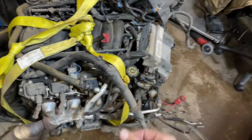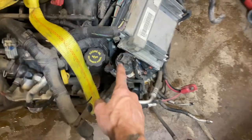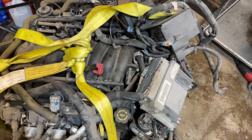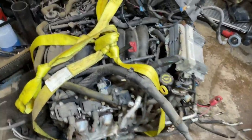As I was saying — fucking distracted, ADHD, whatever — we're going to remove all the stuff like the exhaust gas recirculation system, we're going to remove that. So all the wiring that went to that can be pulled out of the harness, all the wiring that went back through the firewall to the body control module — all that stuff can be removed.